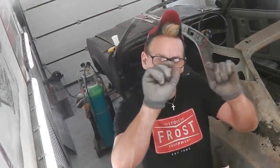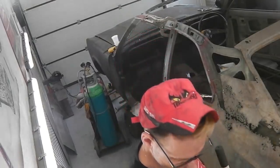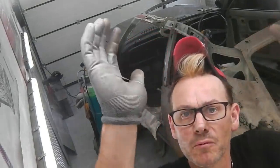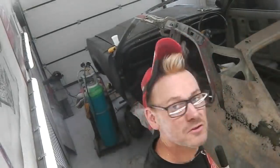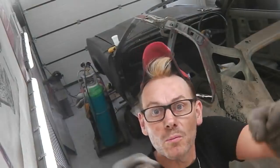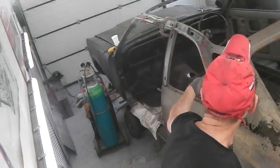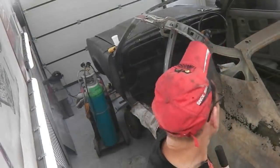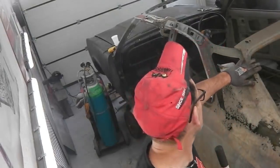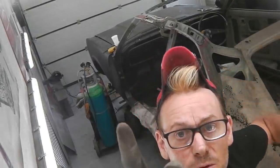We're gonna just clean sand the back of that lower flange there. It's probably just, it's not going boom, but the rest there, as you saw, we got a good run there. Boom, boom, boom, boom. Okay. Yeah, it's probably just a little bit of surface corrosion on the back. I didn't actually clean this metal, I should have done. So I'll just scotch pad that and we're off.